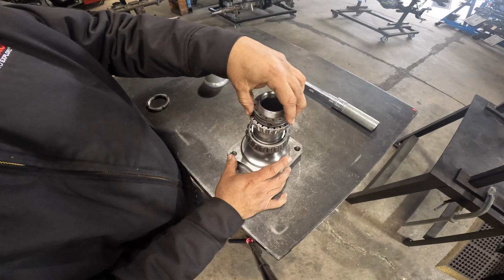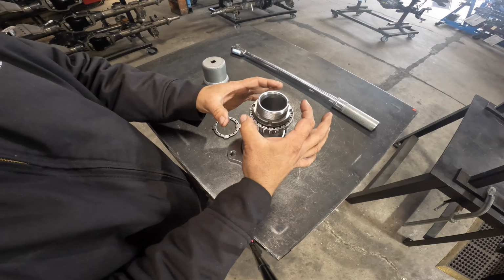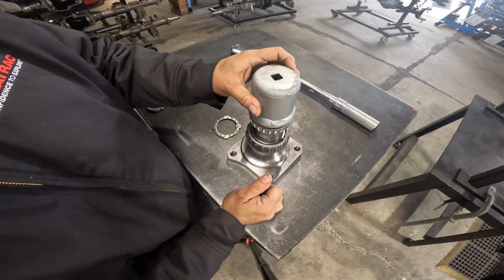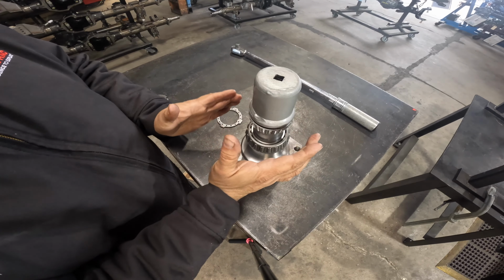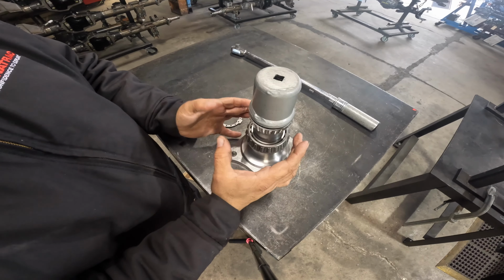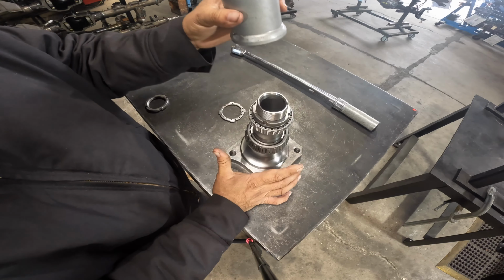So as you can see, either way I flipped it, it didn't line up. So what I'm gonna do next is I'm gonna snug that. So I grab my 4-point socket again. I'm gonna give just a little more. So I'm gonna tighten it slightly. I'm not gonna loosen it because I don't want sloppy bearings, or I don't want to mess up my preload. I'm gonna tighten, so just a slight tightening right there. Maybe that much should do it, right?